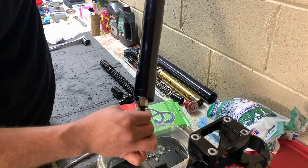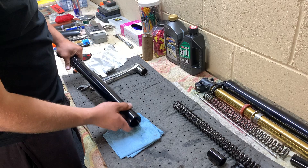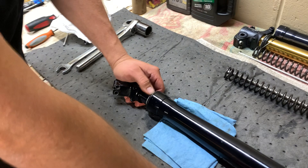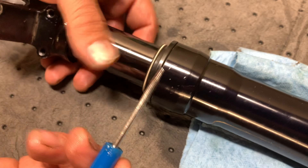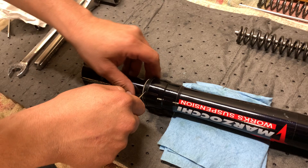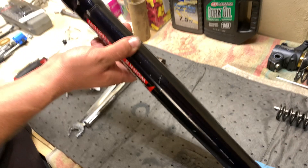I like to double up the pig mat so when you flip the fork over, the oil coming out won't pull on your countertop. The next part — be careful: if you slip and gouge the stanchion it's over. Use a little pocket screwdriver and just work it around to free it out until you get movement. You'll feel a lip in there — once it comes past that lip you're home free. That's your dust seal right there, the lowest seal on the system.